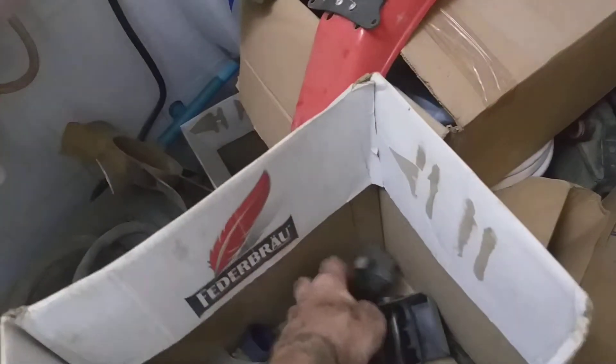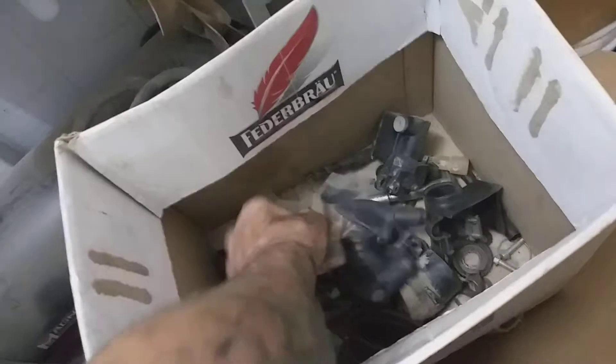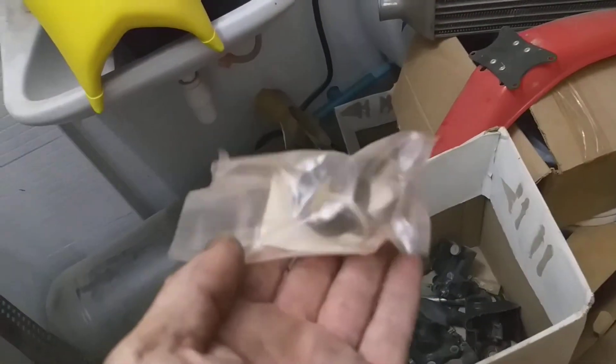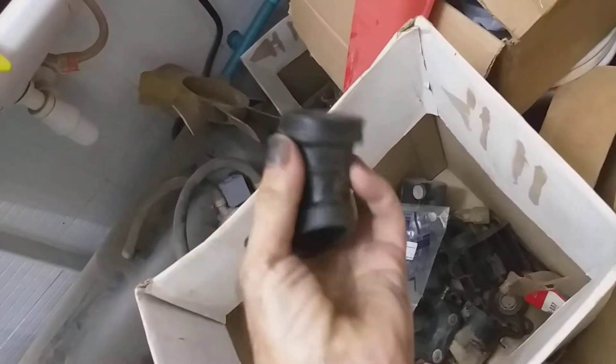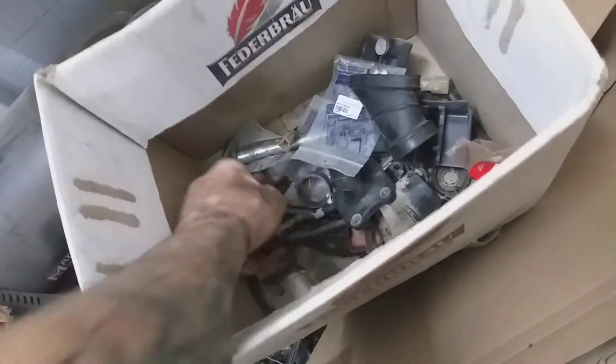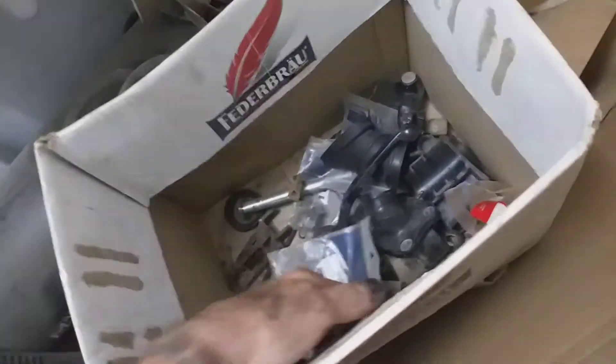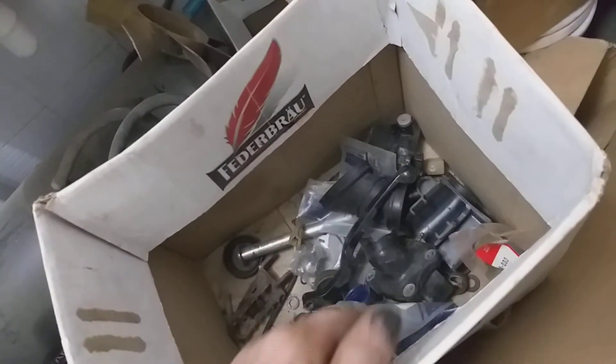Whereas I bought all new rubber from Japan. I've also changed every single fork bush and obviously the seals. Here's the air intake rubber — that is rock hard like a brick, look at it. I am squeezing it for all I'm worth — it's as hard as PVC. I'll be changing that.